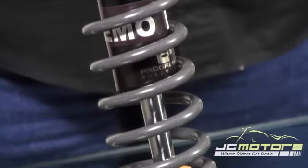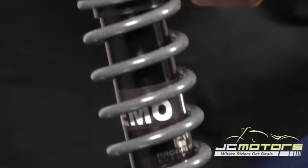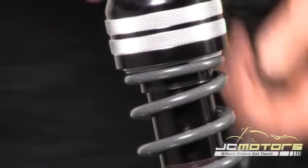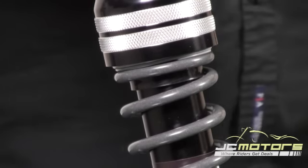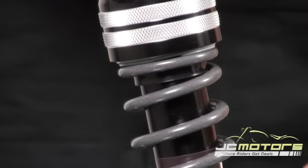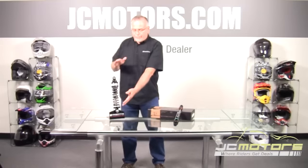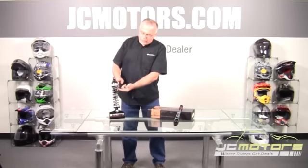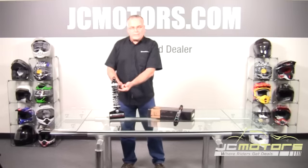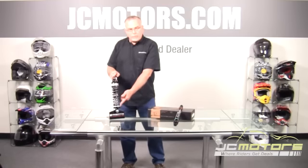You're probably wondering: what happens to that last inch of space? If you look up underneath here, you can see a slightly lighter gray-colored spring. That's what we call a compensator spring, or a secondary spring. As this shock comes out of the box before it's installed on the bike — it's 13 inches in length. However, once installed, the weight of the bike itself will literally compress that spring to a solid stop, thus making the eye-to-eye distance of this series of shock 12 inches.